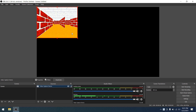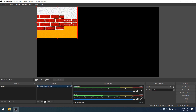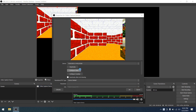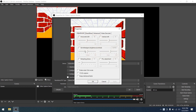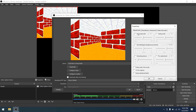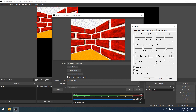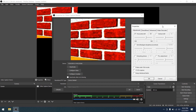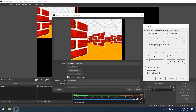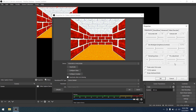We can click OK and we have a nice 800 by 600 image on a 1920 by 1080 backplane, so we've got a little work to do to make this nice. Back into settings, I can go into Configure Video and show you how horizontal shift works. I don't really use the other features. Under horizontal shift, we can slide the image left or right, which is very handy because sometimes video cards don't always line up. You'll see it freeze as it applies the shift.